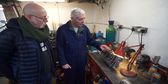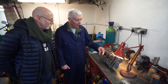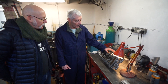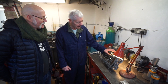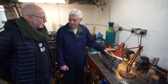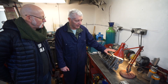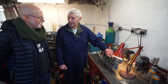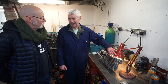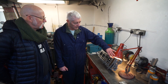Does that compromise the design of the head as far as the forced induction question goes? Yeah, I think it does. This is not one of the best heads I've ever seen. But today, if we're talking about porting and polishing and gas flow — there is no gas. We're changing the shape. The polishing is just a sales thing. If it's not shiny, you can't sell it. So the polishing doesn't gain you any power? No, it doesn't gain you any power. The thing that matters is the shape.